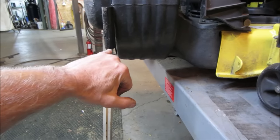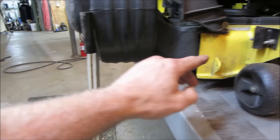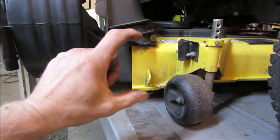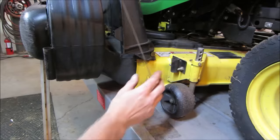I think we could probably do like a washer. We'll weld a washer when we get the right height. Put a washer over it. We'll tack that and maintain that one. We'll probably do the same on this one. We'll weld the washer on the top side. And we can kind of fudge, you know, if we leave them alone on the long side, give us a little bit of working room. Right, let's go get a piece of wire.